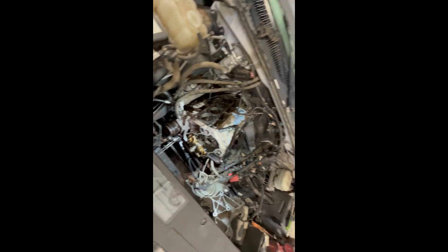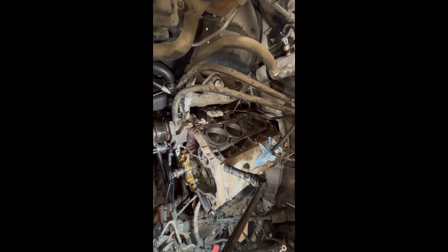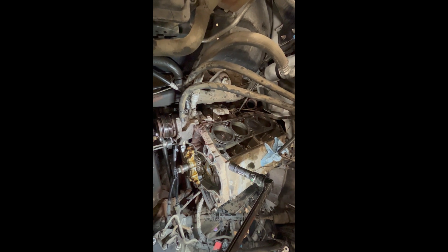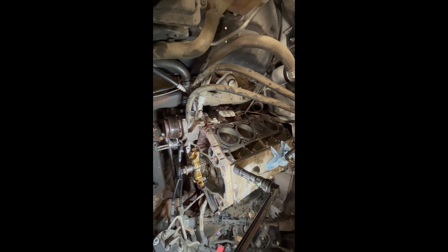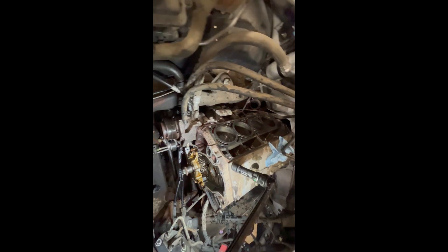It stinks that we lose a cam because these cams are like four to five hundred dollars depending on where you get them. The LS motor is actually a pretty friendly motor to work on and you can do it. We're going to get a new camshaft in it, a new set of lifters, deck the heads, check the valves with a vacuum test, and since there's only 90,000 miles we'll probably put the heads right back down. We'll clean it up, re-gasket it, and send it down the road.